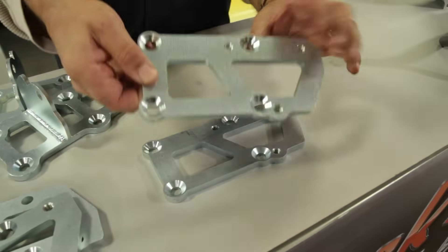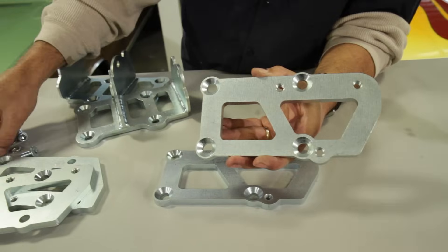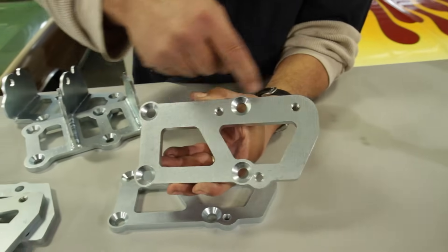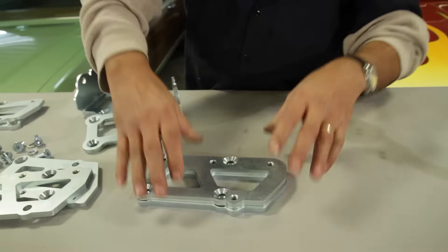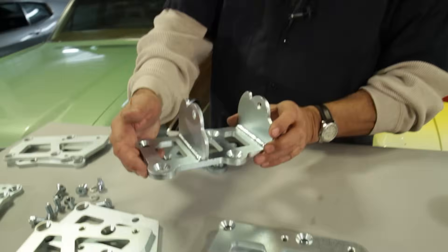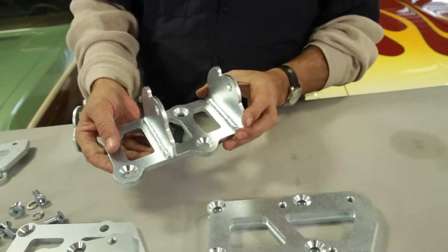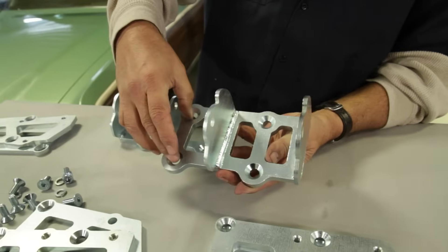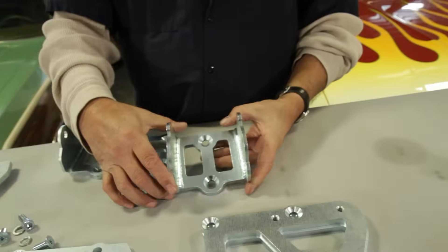The way these things work is they attach to the block with four special bolts - they've got a special beveled head and they bolt right up to the block. These three holes are where your original motor mounts go. They bolt right up and allow you to slip the thing right down into place. If you're working on a car that has late-model clamshell-type motor mounts - I think they started using those around 1973 - then this is a brand new item Hooker has come out with. It's going to allow you to put an LS motor into those applications as well. The clamshell mount slips right into place with the same four beveled bolts. These also move the motor up half an inch in the engine compartment and forward an inch and a quarter.